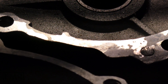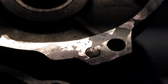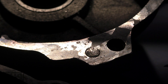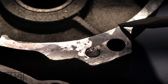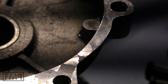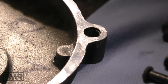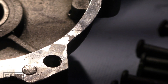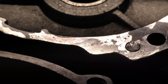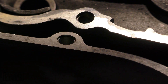Now have a look at the latest cases from 2001 on — you see this? There are marks, there are marks, there are marks — it's not even over the surface. You see all of these cases later than 2001 look like this, which simply means that they are not properly machined, both halves — the small one and the big one.